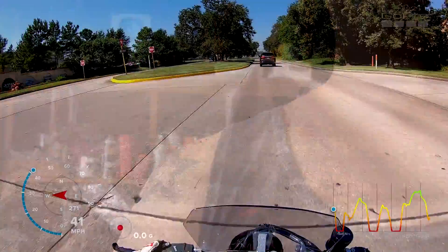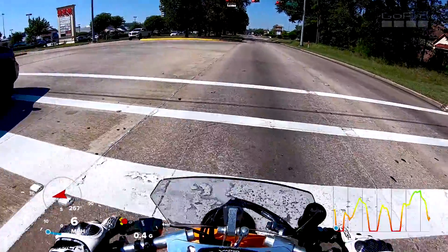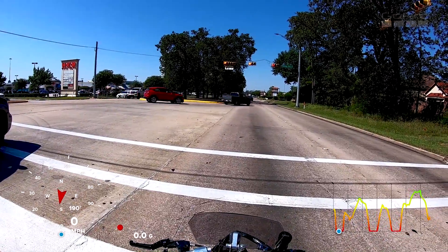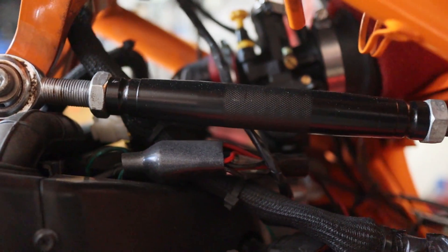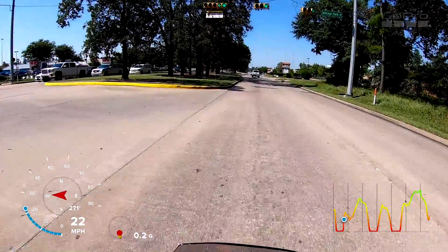This is just a test ride, not a max speed run — the next video we'll do a max speed run. We're going to take our little test strip. It kind of looks like I'm headed that way anyway — I guess I'll go as fast as I can. It is a new belt that needs to be broken in. Quick note: the Password JDM mount has an adjustable arm for how hard you can pitch the mount — I pulled it in a little bit and my vibration in the seat that I used to hit at 40 miles per hour is gone, so the mount was laid over too far.